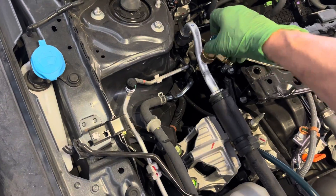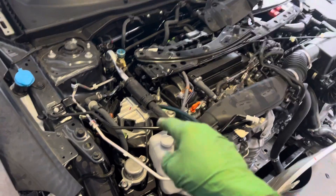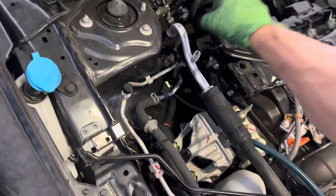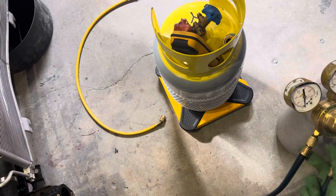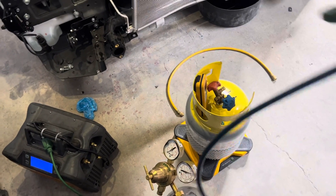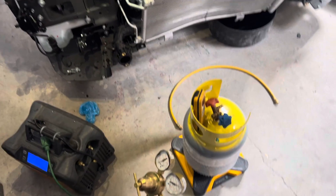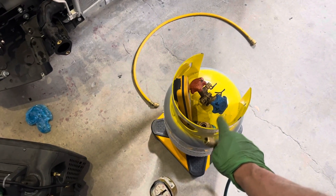This is POE oil — it's extremely hygroscopic. It binds onto that water molecule and does not want to release it just by using a vacuum alone. So do not expose the system to excessive moisture. It's worse with HFO-1234yf refrigerant because 1234yf becomes much more acidic than R-134a refrigerant. That's why the oils are different — they have an additive package in there trying to combat the negative side effects of a higher-acidity refrigerant when it gets exposed to moisture. I hope that was simple enough to explain why you use nitrogen after you perform a recovery.